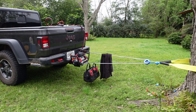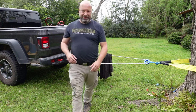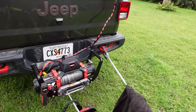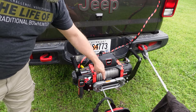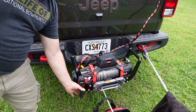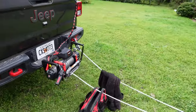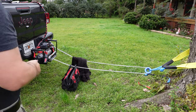That's how the whole process works. After you get yourself unstuck, you will notice a mess on your winch — all that winch line bundled up on the spool. We don't want that. We want it wound on there nice, straight, and even. So when the winch job is done, let out the winch, disconnect the system, and we need to fix that winch line before we can leave.